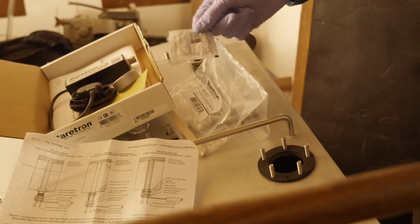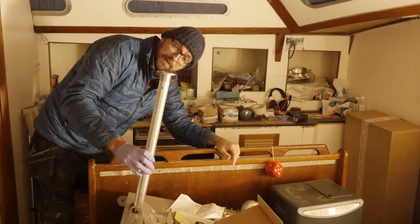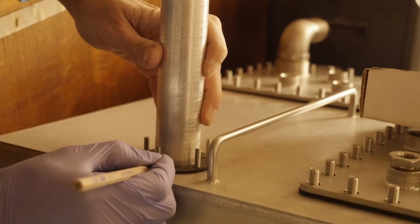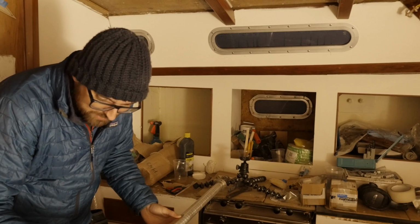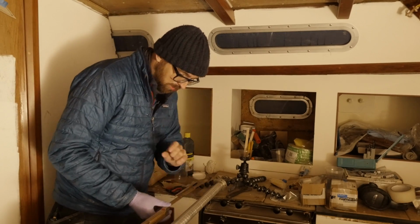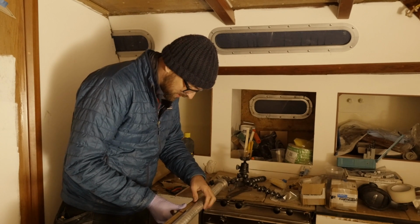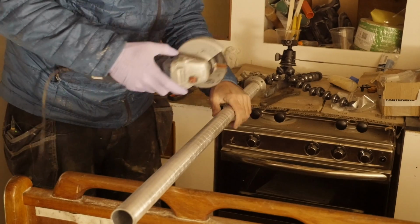But we can go ahead and trim the tube. Yep, only slightly too long. The focus tube protrudes 43 centimeters into the tank. I need about an inch worth of clearance at the bottom, so let's round that off and say I cut the tube at 40 centimeters. This does not need to be pretty.